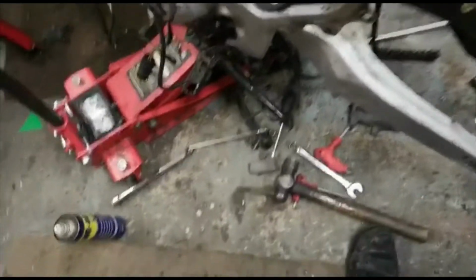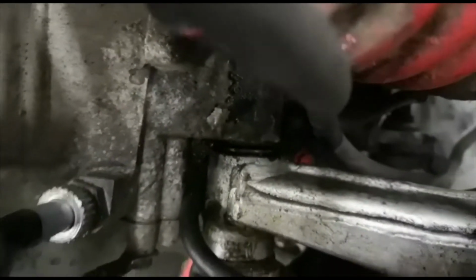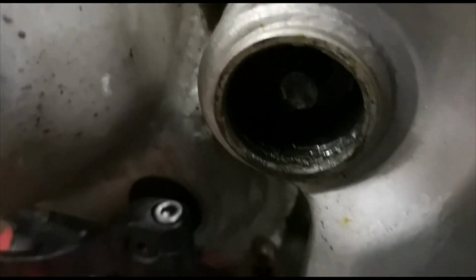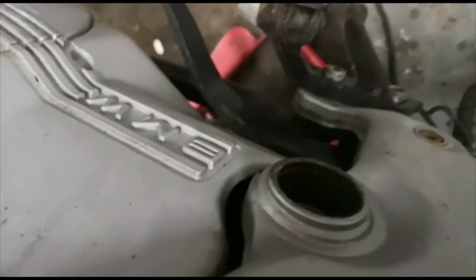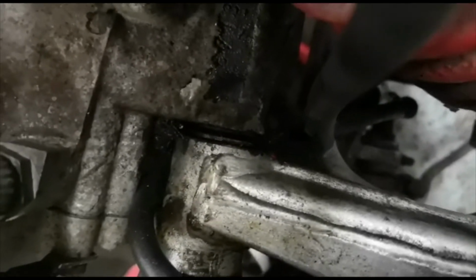Here we are then, state of play. Well, nothing's easy in the world of restoration. Here we have the swinging arm. Remove the nut in there, yep, done that. That came off straight away. Tap it out. The other side, withdraw it. After supporting the weight of the engine, because the pivot shaft goes through the back of the engine and through the swinging arm. Swinging arm pivots on needle bearings. But hey ho, seized in the pivots.